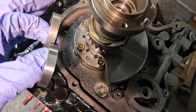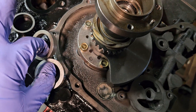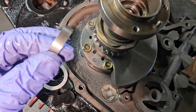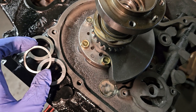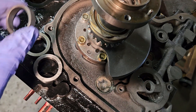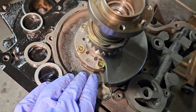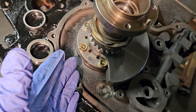Just for reference, RX-8s and FD3S have a larger front end play spacer — a little more robust than the earlier generation RX-7 front end play spacer and bearing assembly. So you can't really mix and match early RX-7 and late model rotary spacers. Whatever you build your front end stack with is based on the front gear and will most likely need to be associated with those parts.